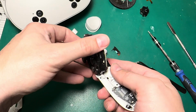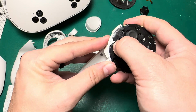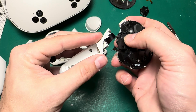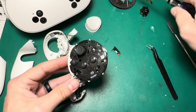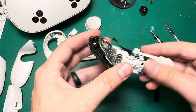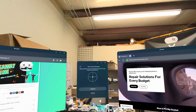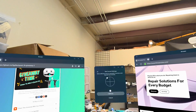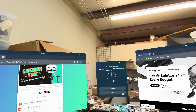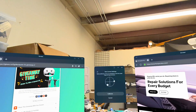Now I want to test it to make sure everything's working right. We'll put the battery compartment back in place — see that little tooth right there and the little gap on the faceplate? That's what I'm lining up. I'll take one single screw so it's stable, slide the battery cable back in, and go test this. We're going to go to Calibrate Left — and if I move the joystick around now, it rests in the center and I can go all the way around the outside. The joystick clicks too. That's all we were looking for.